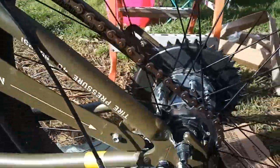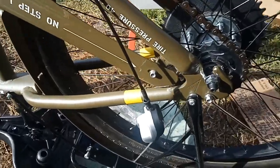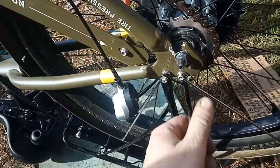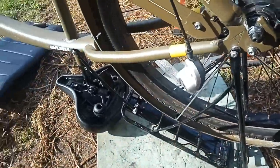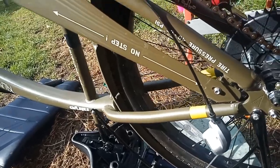So of course the next step is to pop our gear selector on, which of course means remembering to put the pin back in the hollow part there, 5mm Allen to tighten it back up. Then we're ready to flip the bike over and start sizing the engine.